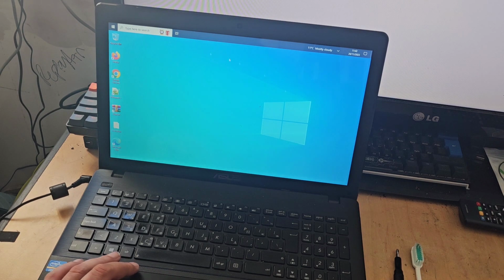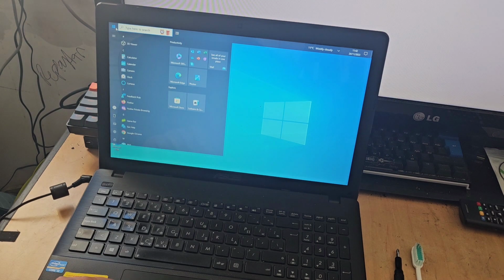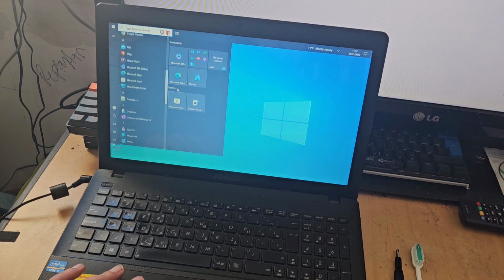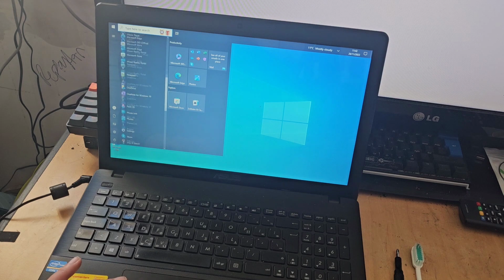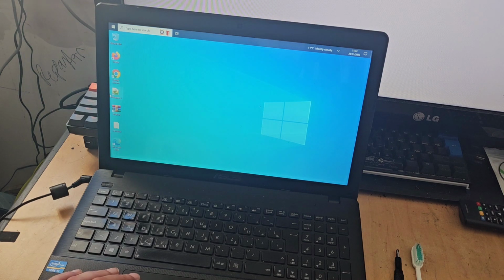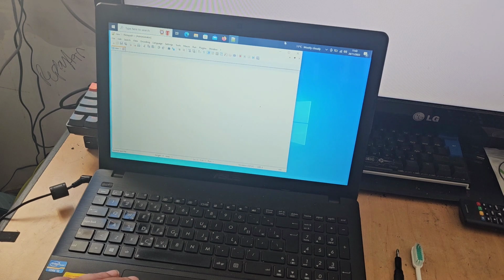Right, Windows has indeed this time loaded up. That was a little bit quicker with an additional 2 GB of RAM, but that is still slow, as you see. So I'm now thinking it's definitely the hard drive. Yeah, there's a little bit of jitter on there when I do that. Let's see if Notepad opens up. That should have opened by now. And all we've got next to our mouse cursor is a spinning donut icon. Notepad++ opens fine, but that took a while.